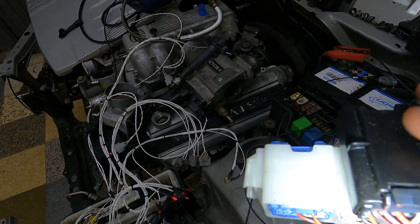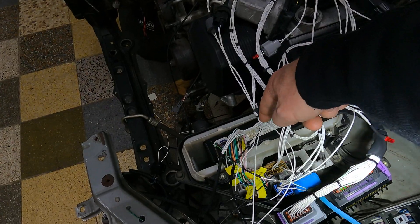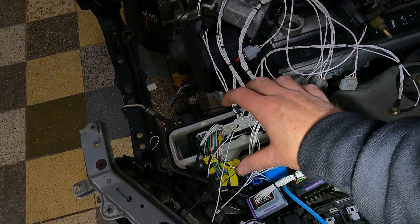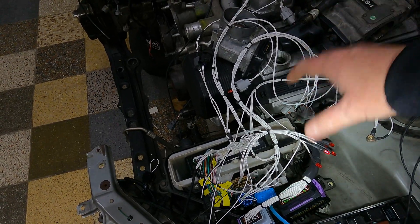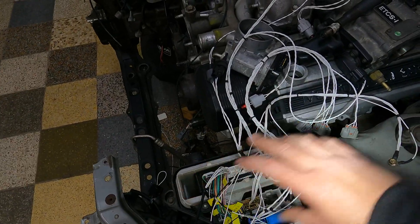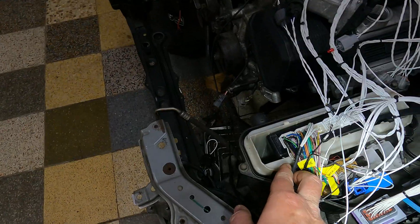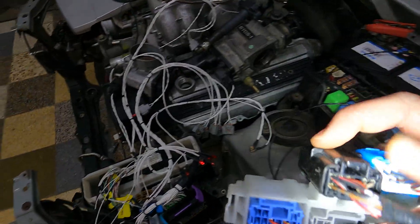So that's the easiest way to read the plug. For the MAC boost valve, it comes into the harness at pin 24 and goes into the black plug pin nine — that means it becomes part of the engine harness. You can then remove the engine harness with the MAC sub-harness without any loose wires. If you want to pull the engine and engine harness out, no problem at all. Now for the wideband we need power, and looking underneath the black plug you'll see a black and red wire.